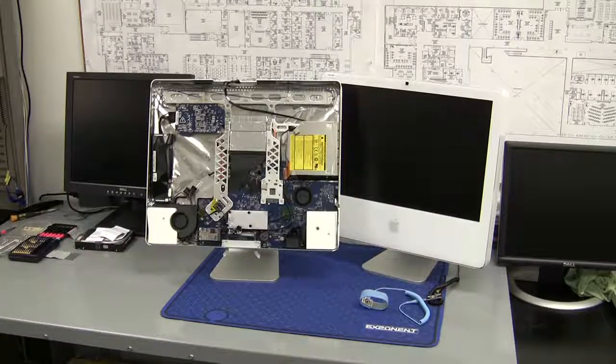This is not right. You have to release the two fingers on the very top of the computer on the inside or you're risking breaking something. If you break these fingers, or if you break this panel, you're going to have some issues.